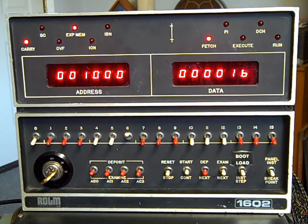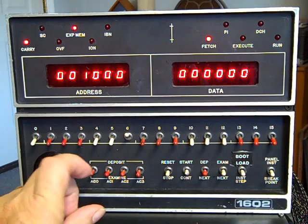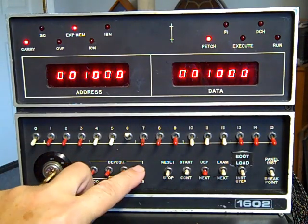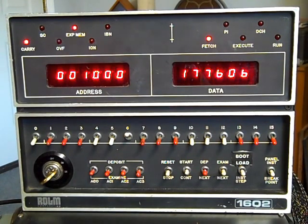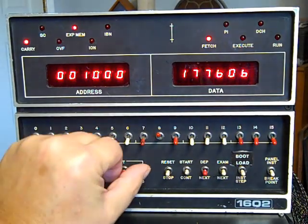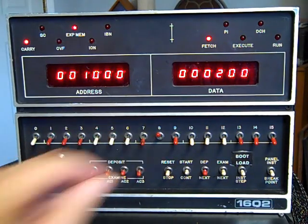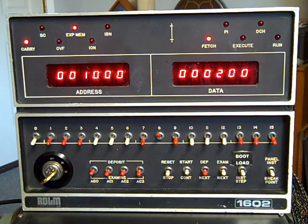In addition, I can also look at the four registers in the machine. The registers, or accumulators as they're called, are 0, 1, 2, and 3 — four registers total. You can examine register 0, which has a 4 in it; register 1, which has nothing in it; register 2, which has 1000 in it; and register 3, which is 177606. If I wanted to change the contents of a register, I could use deposit. That was register 3 with that number in it, but if I switch the deposit, I've now deposited 200 into that register. If I go examine, that's what I'll see.